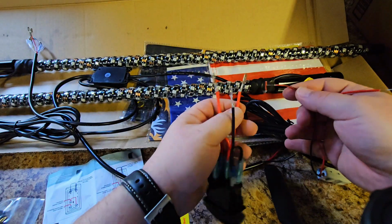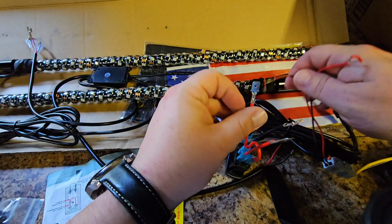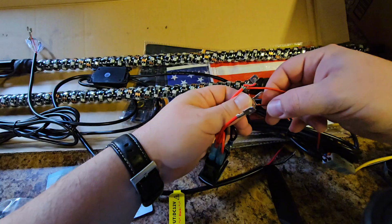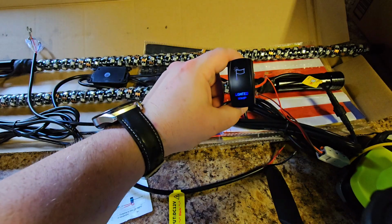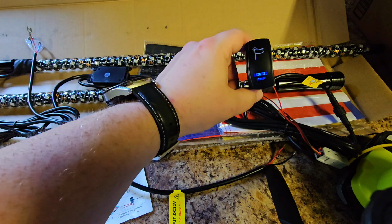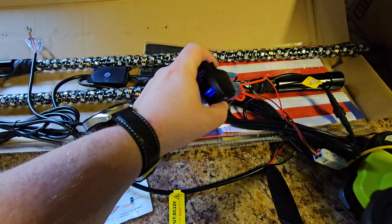And so this one says, if we look at it, this one that's connected to 2 will go to our battery. Let's do positive. This one will go to our negative. And if we pretend like we're turning our key on here, we see that that light comes on. So I just turned my key on. Now, if you've got this hooked right up to your battery and you wire it this way, the key was already on because there was no key. So this way you can turn off. You get in your ride and you turn the key over or ignition power on. That's what it will look like there.